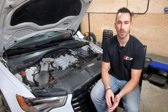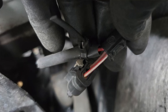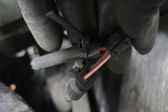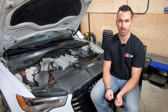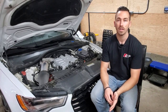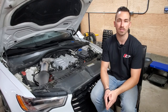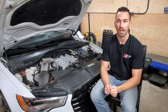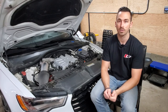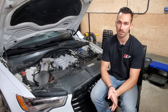There will be a soft check engine light for the pump being in emergency mode, but soft means it won't trigger the light on the dash. In the picture I used some heat shrink, melted one end, slid it over the terminal blade, zip tied the other end protecting it. If at any time I need to re-pin it back into the terminal, I can remove this cover and I'm good to go. Unpinning my CWA50 improved my IAT recovery time after a pass and the efficiency of the loop in daily driving, because any forward movement of my A6 would ingest cooler fresh air across the heat exchanger with the loop flowing at full speed.